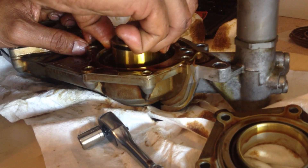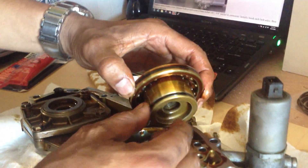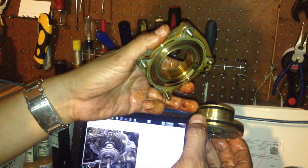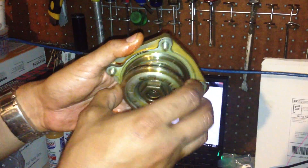It's really strong actually but it has a little wobble right here — that's where it makes the sound. This is the cylinder, and we're going to change the gaskets with the new ones. We're also going to take this part out to change all the rings inside. If you notice, if the cylinder moves like this, the silicon chrome ring — or copper ring — is worn and that's why at low RPM it goes rattle-rattle and makes the rattlesnake sound. That's the ring we're going to change.